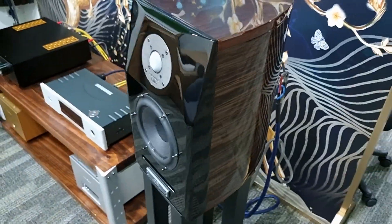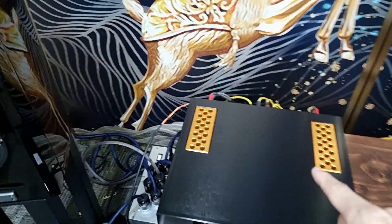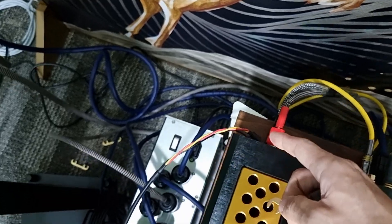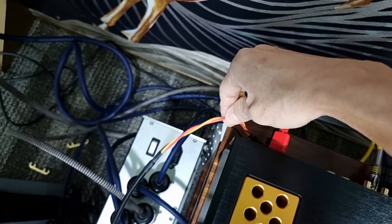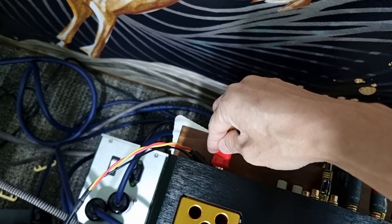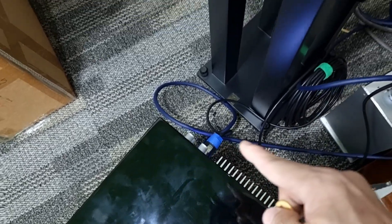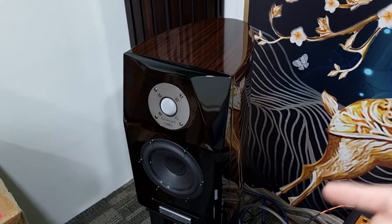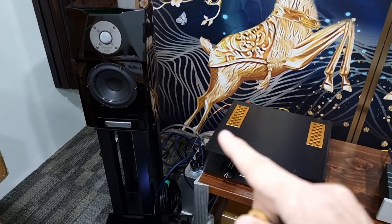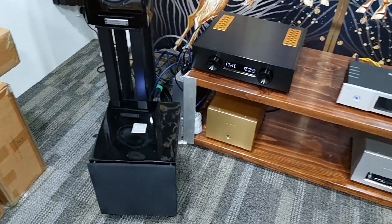It's a pretty nice pair of loudspeakers. The REL subwoofer is connected to the EX-M1 speaker output. You should always refer to the subwoofer manufacturer's manual for the high-level connection. According to REL, connect the yellow and red colored signal to the positive terminal of the binding post, and the black to the negative terminal. The crossover setting on the subwoofer needs to be set according to the bookshelf loudspeaker's frequency response — this pair does about 65Hz to 22kHz, so I set the crossover to slightly above 60Hz, probably 80Hz, so there is some blending between them.